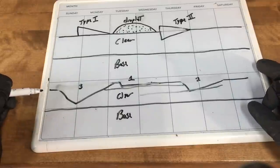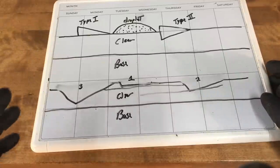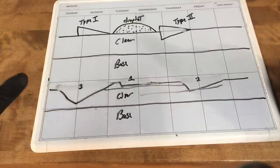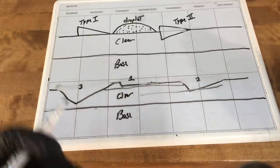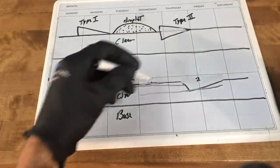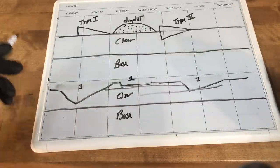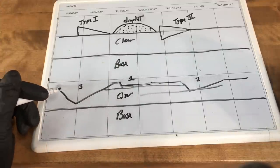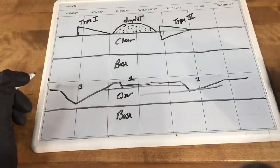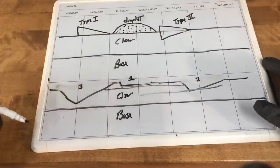The second phase takes more work — a multi-step correction and may even include wet sanding. That's a fix where you'll want a conversation with the customer about expectations. If he wants them gone altogether, you can shave that deep into the clear — just have him sign off on the paperwork, because there's a trade-off from shaving the clear too deep.